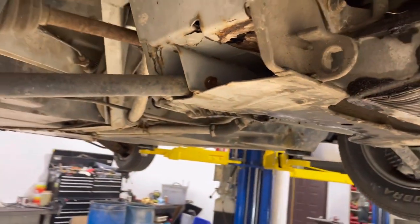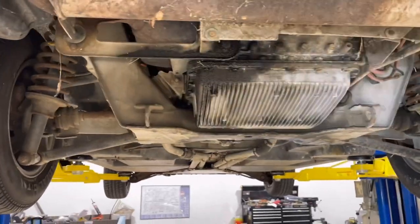If you're going to deal with rot like this, you want to know what you're getting into. This is one of the worst frames we've seen at DMC Midwest as far as deterioration and frame rot. We actually did a frame swap on this car - this frame is not going down the road again. This car sat in a garage up in Wisconsin right next to a lake for about 30 years, on concrete. Every time it got warm the concrete would sweat, then freeze hard in winter - a ton of moisture. The owner also drove it in the winter, so it had seen salt and a lot of winter driving, which didn't help.